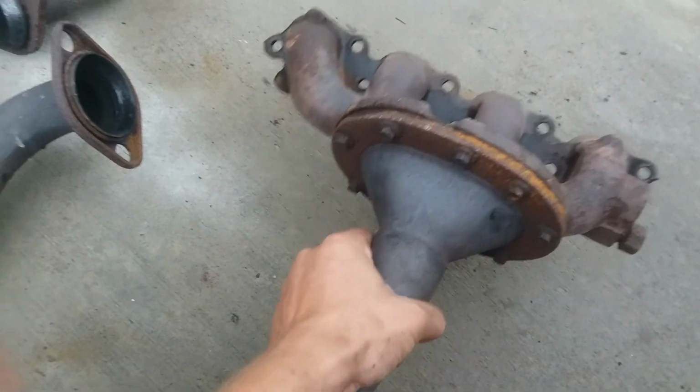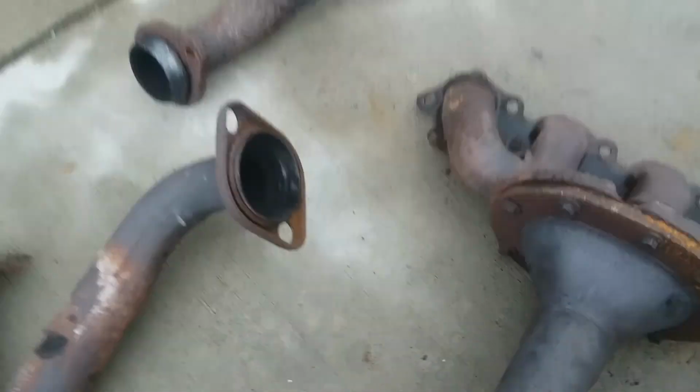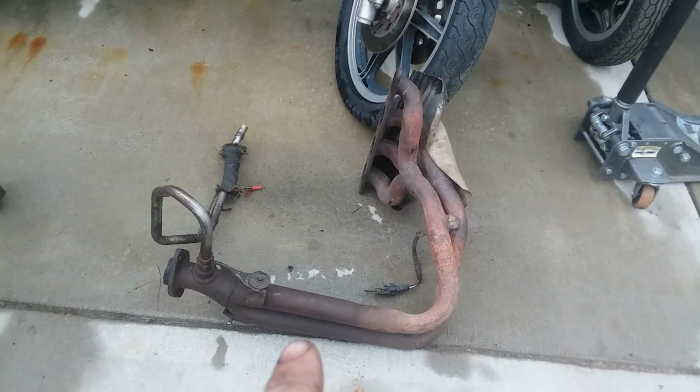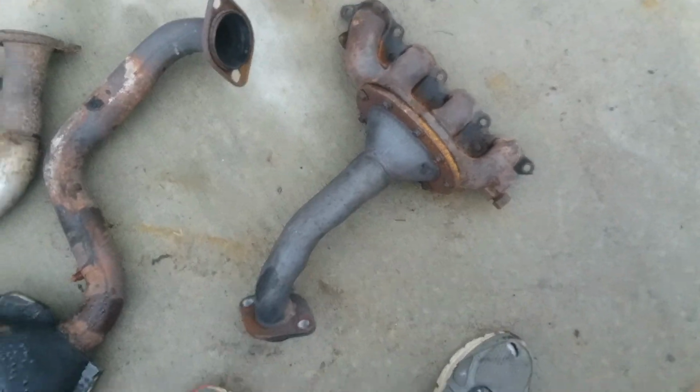So it looks just like that, but we'll have the final collector before the bottom curve, so we can fit this in here. That would be ideal, because then you have a full header system at only this size. You can remove it by itself, or you can remove it with the engine head, or you can remove it with the entire engine. And that would be beyond ideal for me. It obviously wouldn't have as much top end horsepower as the long tube headers, but it would be a much better setup than what these base systems are.